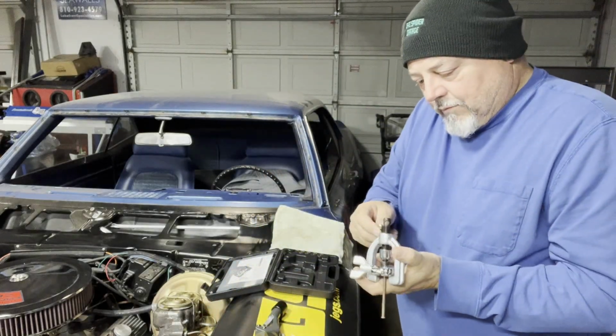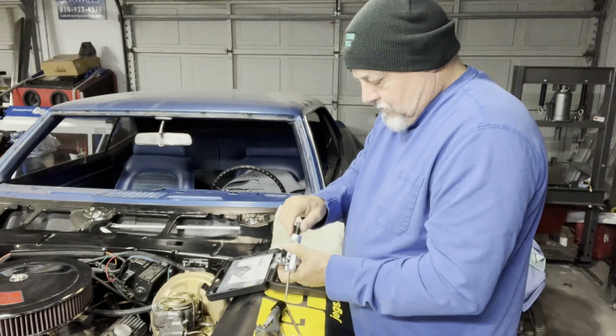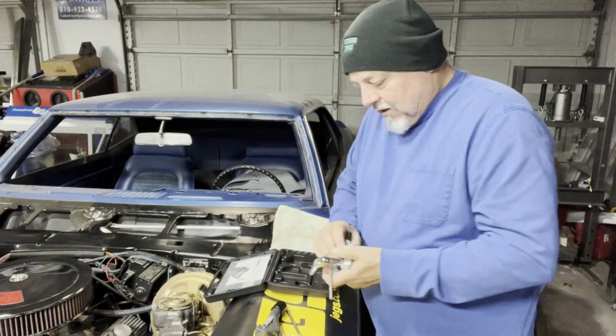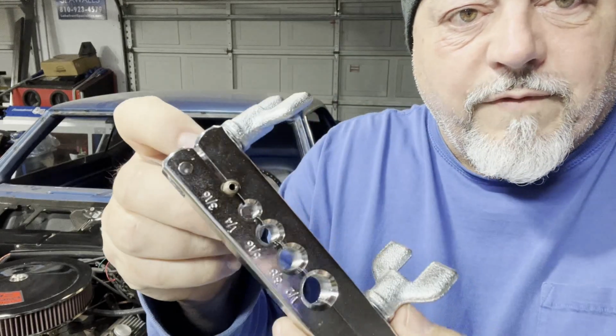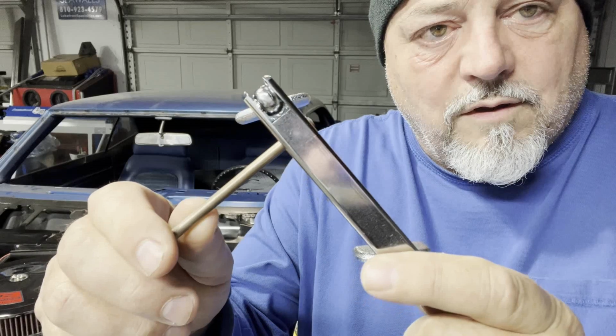Now I'm going to remove the press tool. I'm going to remove the die and show you what the form looks like at this stage. We're going to call this the preform, just like in making a body panel. Most of the time there's a preform operation, like on a door or a roof, a hood, any kind of a closure panel like that. They require a preform operation, and then they go through restrikes and flanging tools and things like that. This would be called the preform. See what it looks like? Okay.